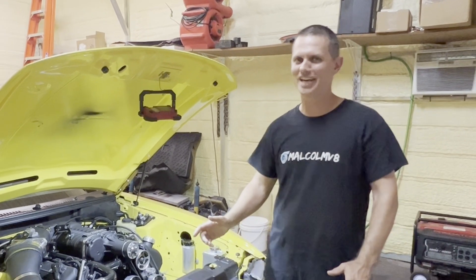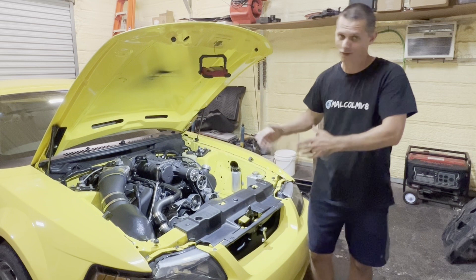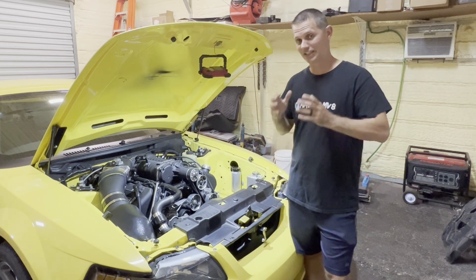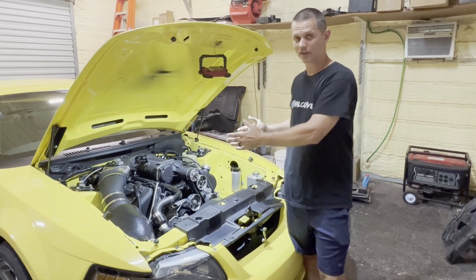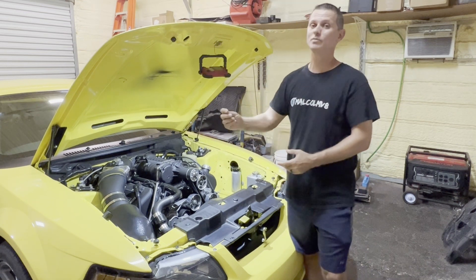Welcome back to the channel. Today we're talking dual widebands on V8 engines, or V6, V12, whichever. From time to time I run into this because a lot of people and a lot of cars that are tuned only have a single wideband. A lot of guys don't want to put dual widebands on there, and it becomes very important when you have two banks of cylinders, because you're just assuming the other bank is doing the same thing — and that's not always the case.